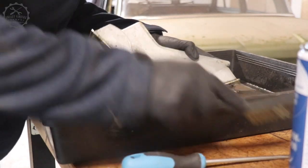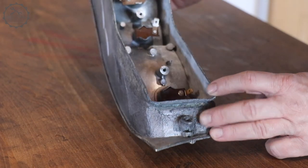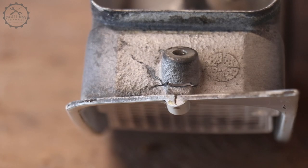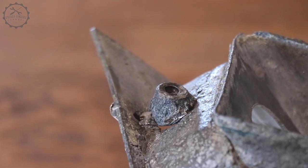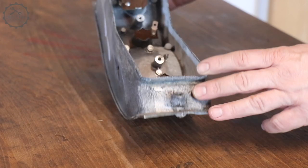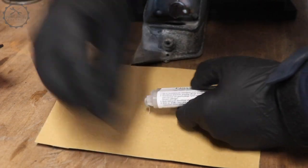When finally I had cleaned the housings properly, the findings weren't good. Further corrosion had eaten away parts of these screw supports. Aluminium as such rusts like hell. But the good thing is that the resulting aluminium oxides, unlike iron oxides, quickly build a thin but strong layer that keeps further oxygen away. Remove this layer by stone chips, parts rubbing at each other, or contact corrosion, and the effect will be horrendous.